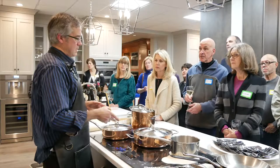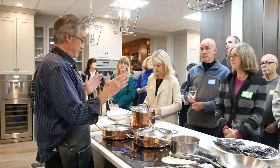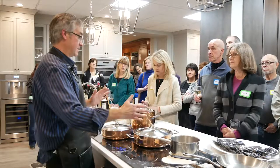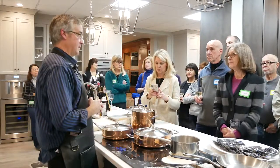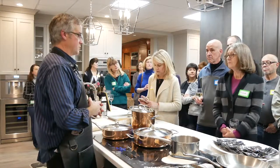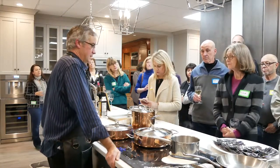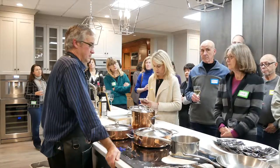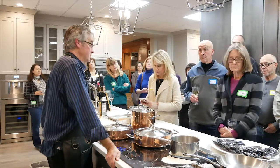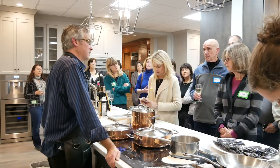120-volt service? Most built-in tops are always going to be 220-240 volts — 30 amps for a 30-inch, and up to 40 amps for a 36-inch. The countertop single-burner pieces are standard 120 plug. In most commercial buildings it's 208 volts, but you're still looking at 30 amps. Individual built-in singular pieces are around 20 amps.